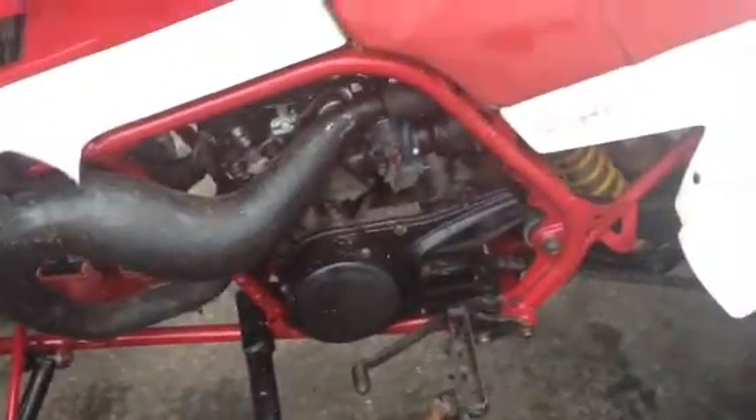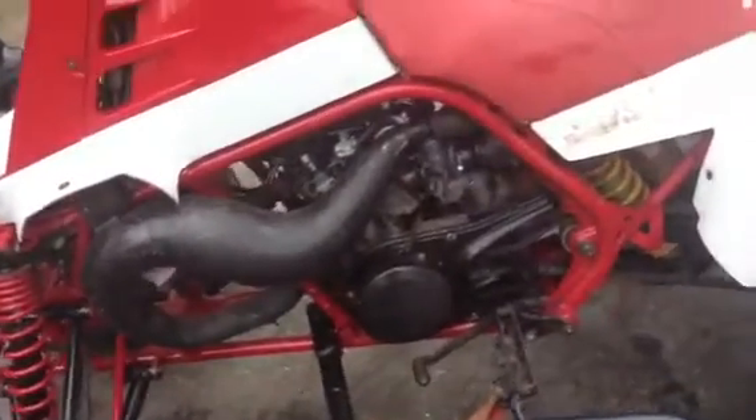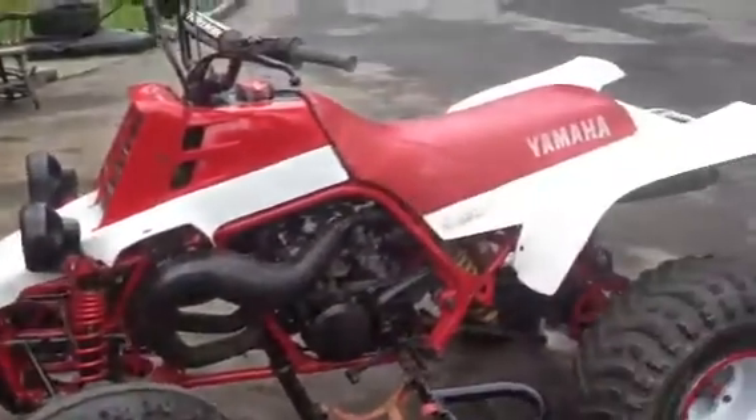I like to just buy new rings since I'm already there. So I went through, put a new clutch, all new gaskets and oil seals. New rings on the piston — the piston was brand new, it's 60 over. Rebuilt the carbs and cleaned them out, did the choke override system kit, new fuel petcock.